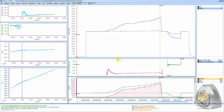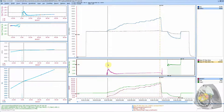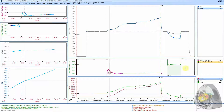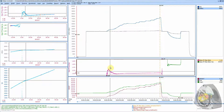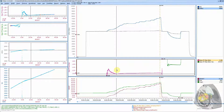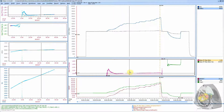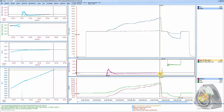If we move over to the positive pressure side — keep in mind we have a 5 bar base relative fuel pressure — as we apply boost pressure, the rate starts off roughly at 1.3 for a very low boost pressure of 2 pounds, then as the diaphragm conforms to the gap in the upper disc it drops down to 0.98, and then we have a gentle rising rate up to a maximum of around 1.05 at our full system realistic performance levels.